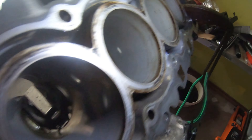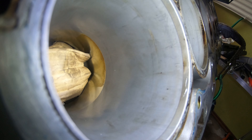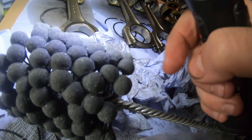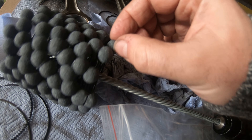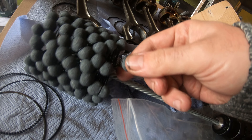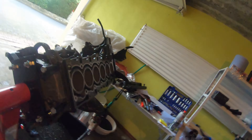Nothing — it's fully smooth. Those marks are from the bore gauge. So we're going to put a very light, gentle crosshatching pattern into the block using this flex hone, or dingleberry hone — it's these carbide pieces on nylon sticks. Let's try this out.